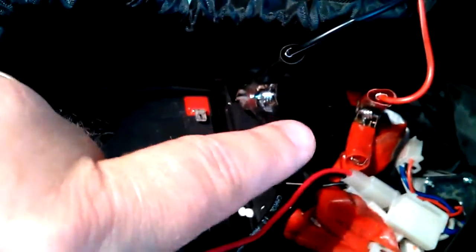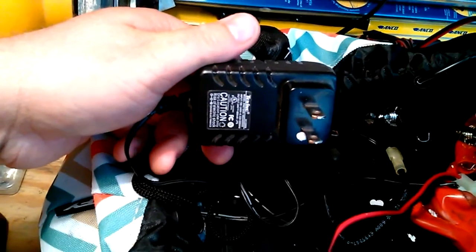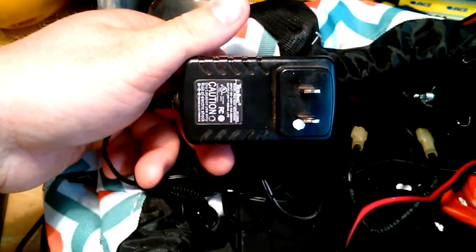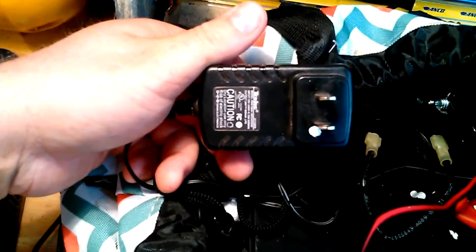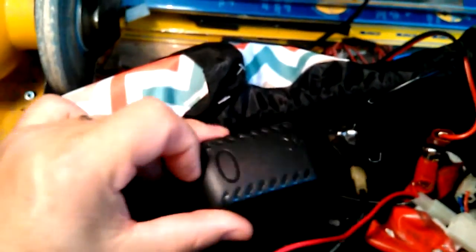The problem with using this 12-volt charger is you have to hook it up to each battery one at a time. Fortunately I was able to reuse a charger from my son's scooter, which is actually how this whole project started — we wanted to reuse the scooter motor but couldn't find a sprocket with an 8-millimeter D-shaft anywhere online. So I ended up buying a new motor, and then decided to buy the full kit including the mounting plate, which turned out to be a smart decision.